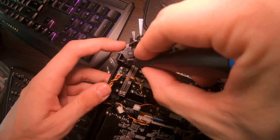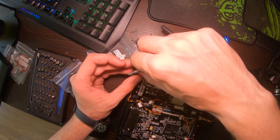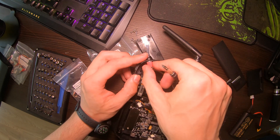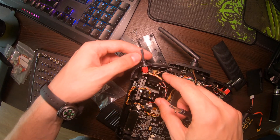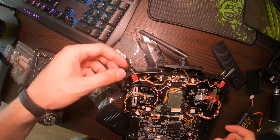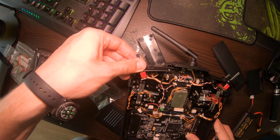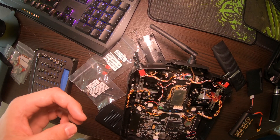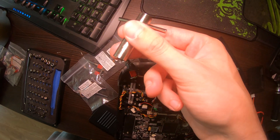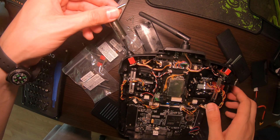Take out those screws, lift that part up and put it aside. Then unscrew this part — you can use your fingers or some pliers. You can also use a specialized spanner tool, which is useful for taking out the switches, though it's not strictly necessary.